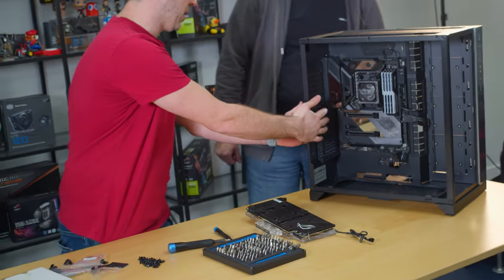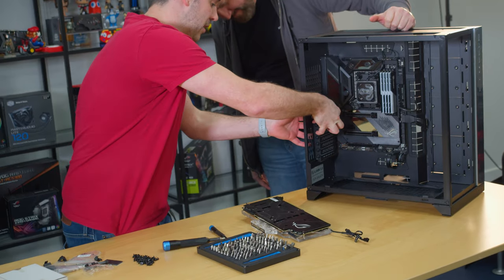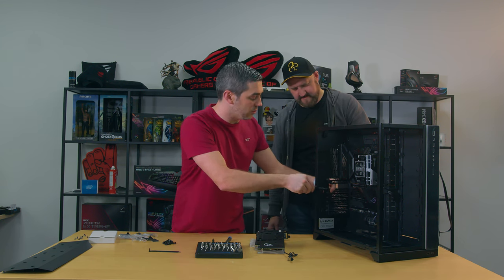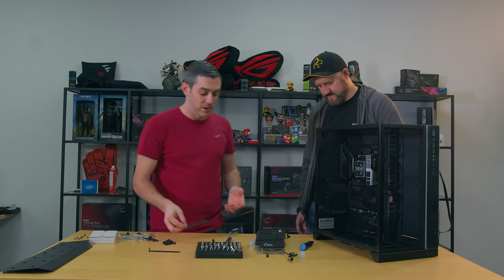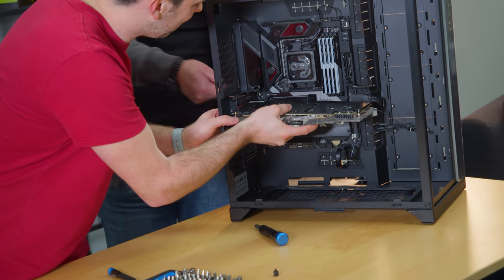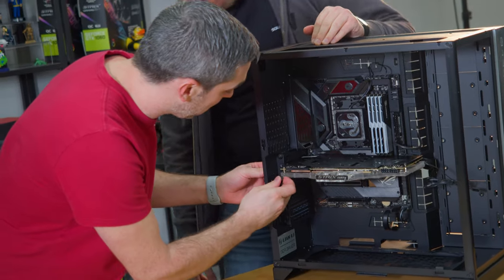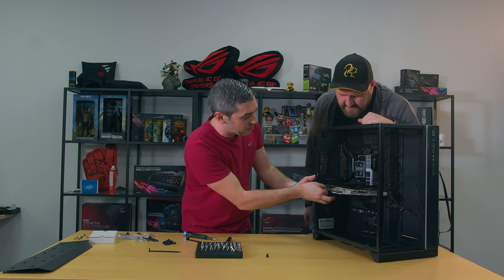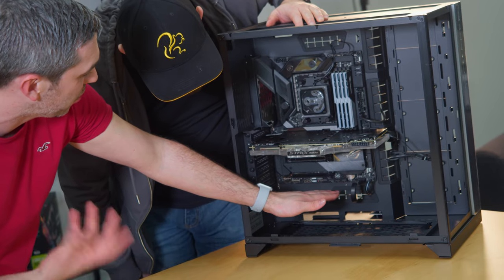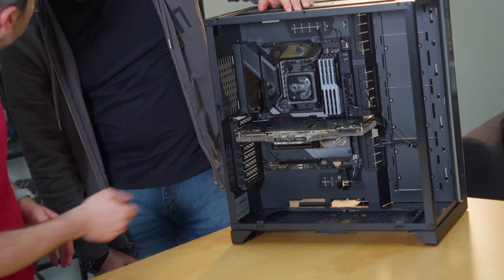Typically you've got your expansion slots here - looking at the GPU and where it lines up with the slot, it's going to be the second slot down. On a cheaper case these expansion slot covers aren't reusable, so if you change GPU slot size you can't put them back. Whereas on this case you can. Now that the GPU's in, you can see how much space we have underneath. Once the rad is in there with fans on top, it'll come up about 55mm - 25mm for fans and 30mm for the rad - but still with lots of clearance, which will allow the RGB to shine and bounce off everything. Power supply-wise, we've got the ROG 1200 Watt Platinum. It's an 80-plus Platinum power supply so efficiency is absolutely fantastic - there's only titanium above it.